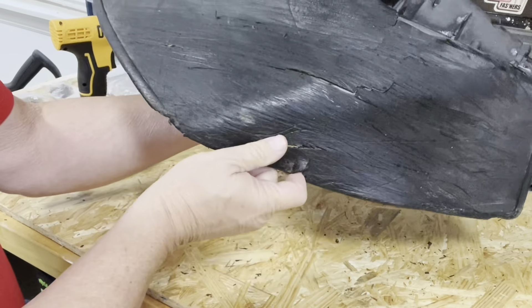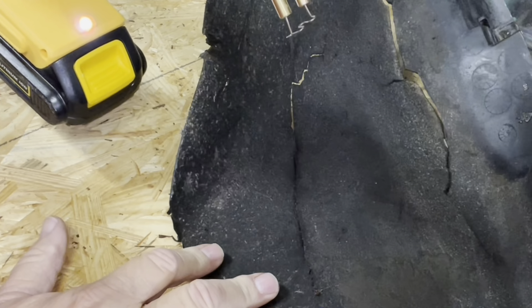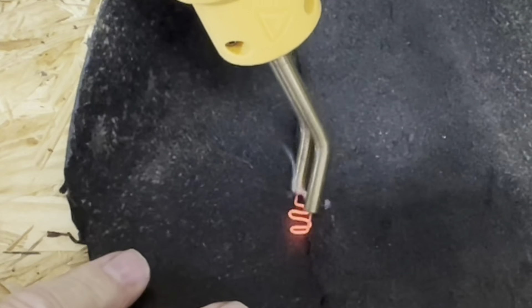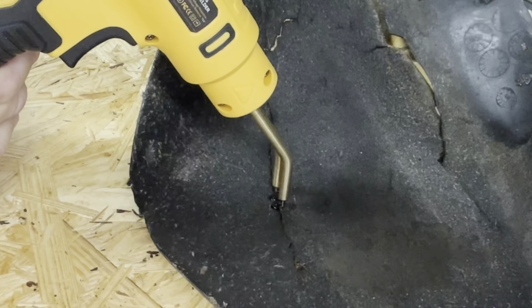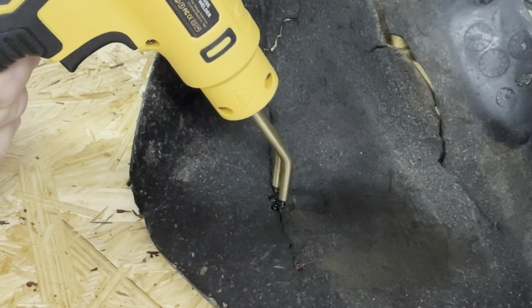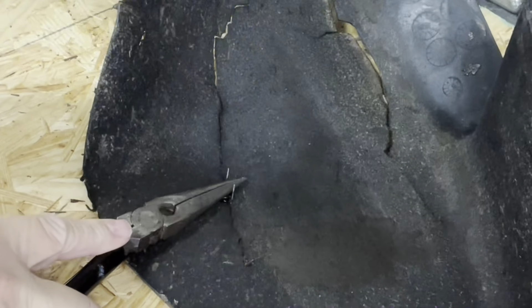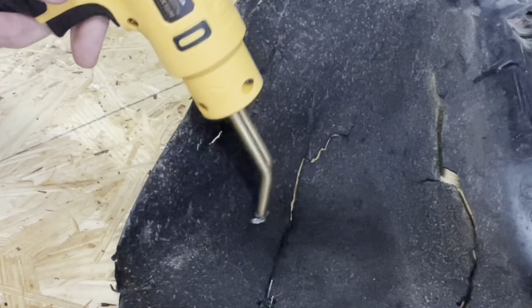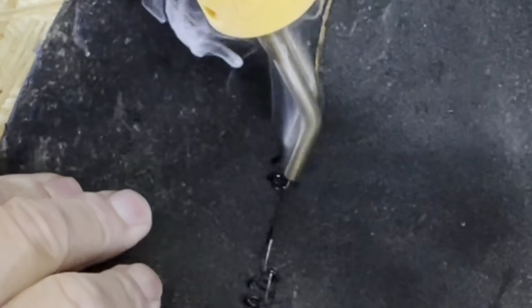This is a look of the flat staple itself — it's kind of a W shape with two free ends. The two free ends will be inserted into both ends of the hot stapler gun. When you activate the trigger, hold it down — you can see it starts to glow. Now it's ready to be embedded into the plastic. You can see the LED light activated where you can see the surface. Once it's embedded to the proper depth, just release the trigger but hold the staple in place. Let it cool for 15 to 20 seconds, and then you should be able to pull the gun out with the staple remaining in place.